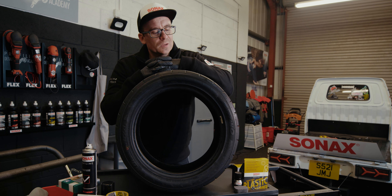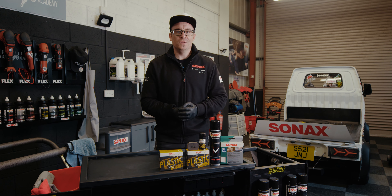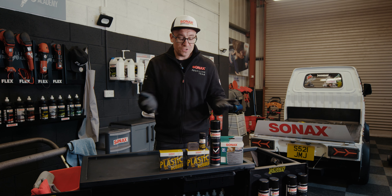The cure time for this coating - and the reason I've done this earlier - is six hours. So the vehicle, the tyres, the rubbers, the plastics need to sit without getting wet or being touched for six hours to help the cure process. It's 12 hours before the product is fully cured, and we don't recommend washing the vehicle for seven days to fully harden, same as our other ceramic coatings. But it's a fantastic finish, a lovely semi-gloss. Look at the beading there - amazing product. It looks fantastic on tyres, so for any unpainted plastics or any rubber part it's amazing for long-term protection. Thanks for watching guys, hit the like and subscribe buttons, leave us a comment or let us know how you get on with it.